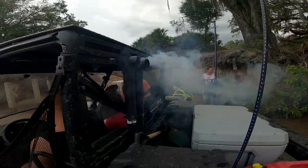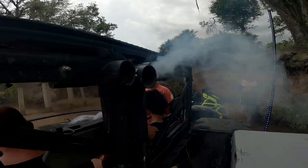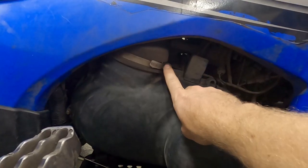Another great thing about this clutch mod is it lessens belt wear. A lot of people have to replace their belt from smoking it when they add bigger tires. This clutch actually clamps onto the belt tighter and prevents a lot of the slipping you see with bigger, heavier tires. I'm actually still on my original belt and we haven't seen any excessive slipping or smoking, but we're about to open it up and see what condition it's in.